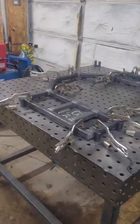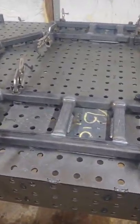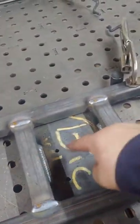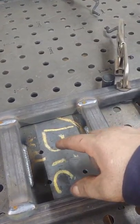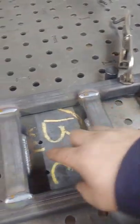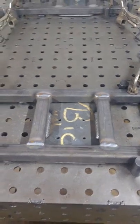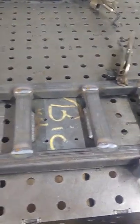This is the frame welded upside down. I wanted to show a couple things that we do that other people don't do that really helps to sturdy our frames up. Safe Wholesalers does not put this in at all. This is exactly on the front side — where the suspension goes — and we have two more bushing tubes and a quarter inch flat piece to hold it on. On the bigger ones we actually add a channel on there to lift it so it can get low enough for the frame.